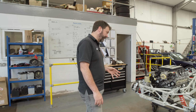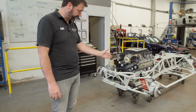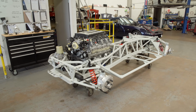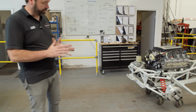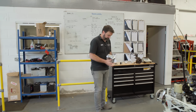So we found that, again, the way we did that was by tuning the roll centre, the wishbone pickup points, the steering axis inclination. By adjusting and correcting those, we kept analysing different setups until we basically got the tune that we wanted in the suspension. So it brings us back to our upright.